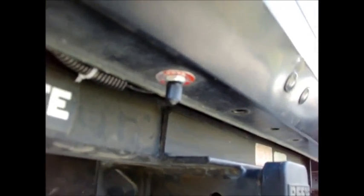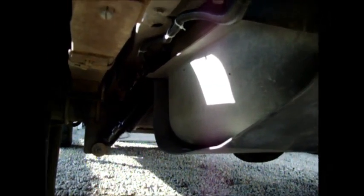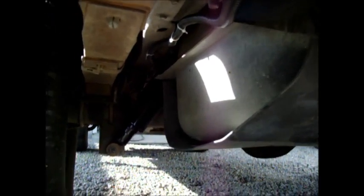That's where I put the air — a little nipple. I put them in the conduit so they'd be nice and safe. The little tubes are fragile, so I don't want them rubbing up on anything and getting air leaks. I installed them real clean. Pretty easy to install — just three bolts per shock, actually two bolts and one nut for the Jeep Cherokee.